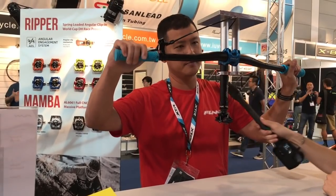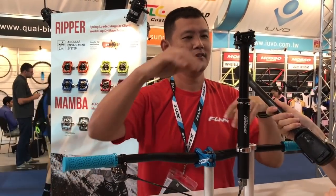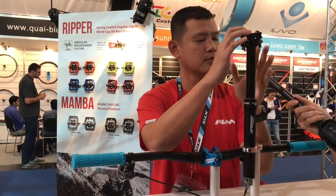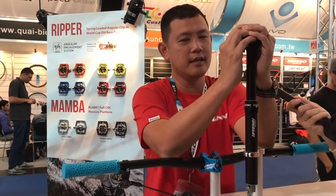The best way to simulate this is basically to turn it upside down and let the air go in. You shouldn't do that, by the way — never ever do that with a normal dropper post, especially on the bike. So what you get is this bobbing effect. That's how it is when you have a six to nine month used dropper post, especially the hydraulic ones — air gets in, they get stuck, and you get this bobbing effect.